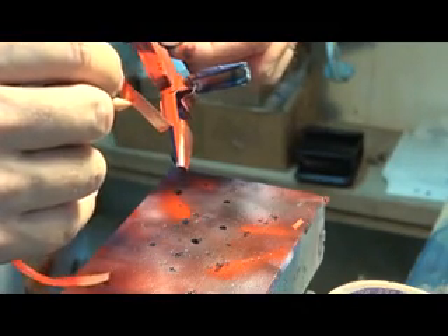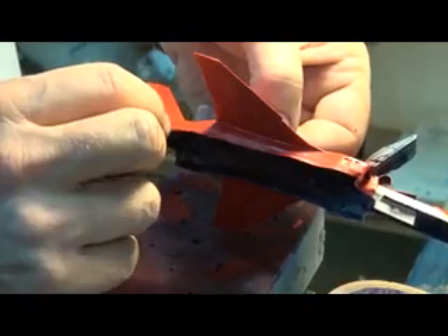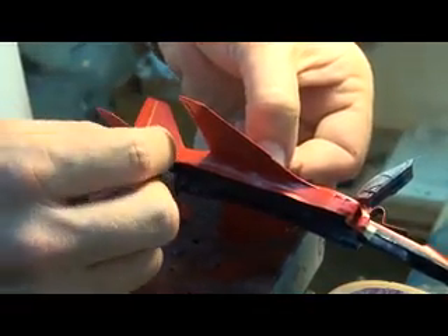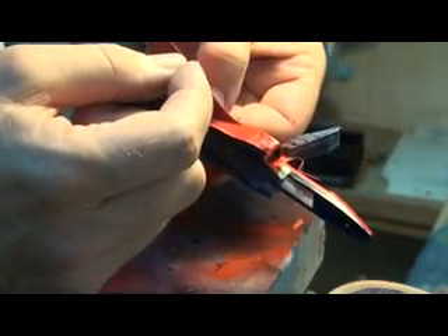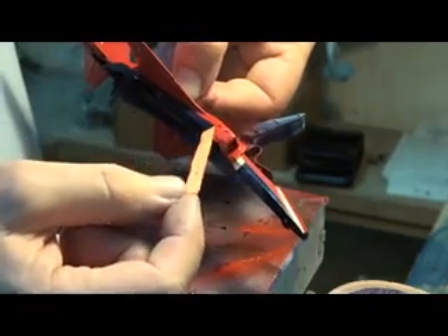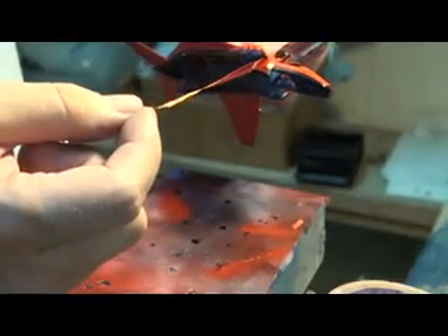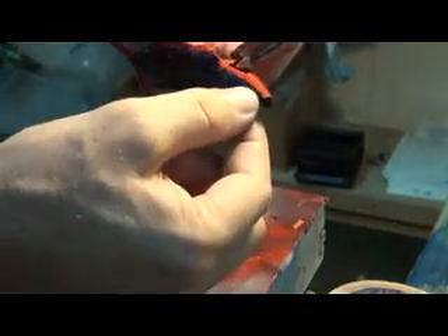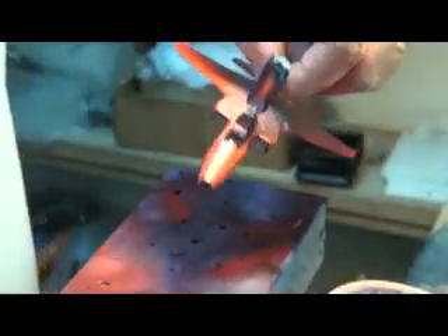The other side is looking a little bit better. There's some blue paint lifting there, but that's easy to touch up because it's not on the mask line itself. The higher quality masking tape you buy, the lower the number of problems like this you'll have with it. This is automotive detailing masking tape, quarter inch, and it seems to be the best that I've found. Carefully pulling the tape away from the job — you can see there's some paint missing there and there, and around the other side there's a large piece that's been torn off. We'll come back and do that later.